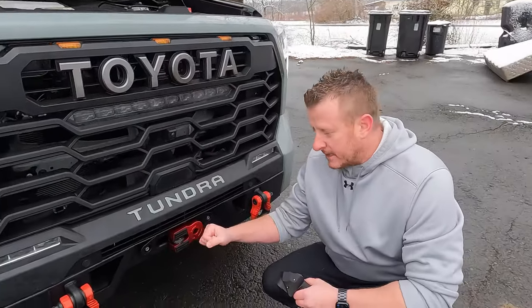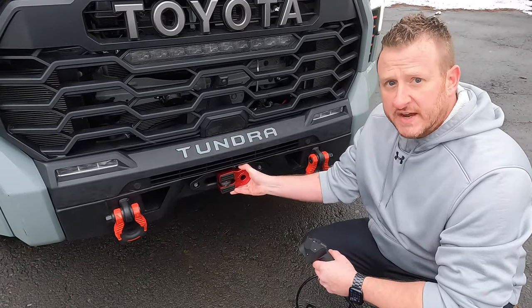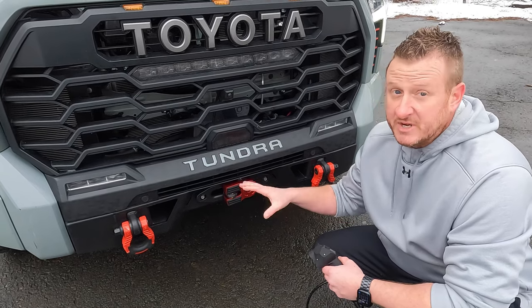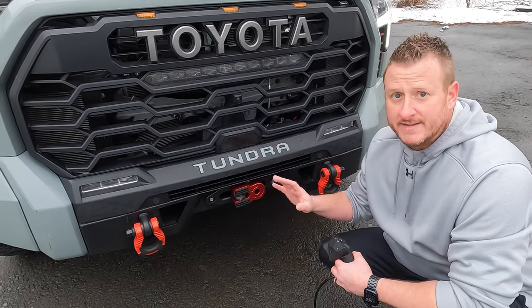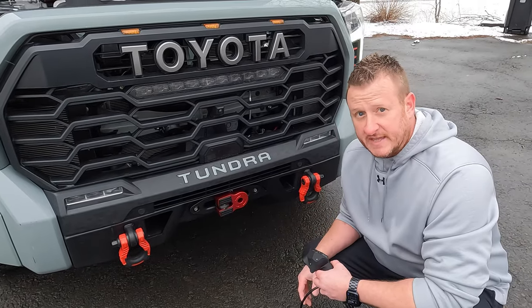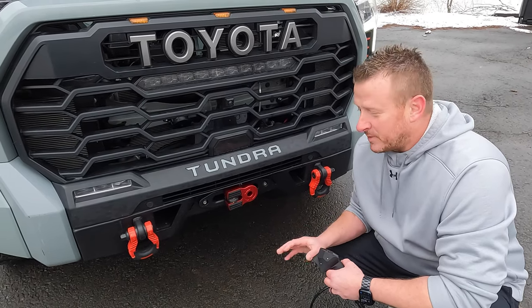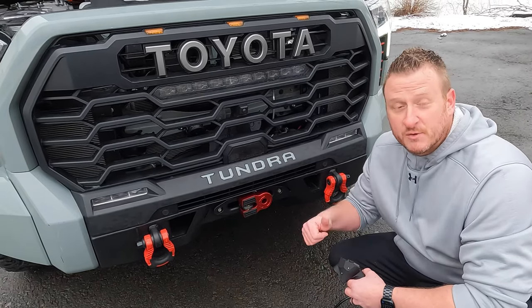I just made sure it's nice and tight — you don't want to really crank it up against the fair lead, but it's nice and snug so we don't have to worry about the rope coming undone. Make sure you're subscribed and turn on that bell. I will show you what you need to do — you need to pre-tension or pre-stretch the rope, whether it's cable or synthetic, before you actually use the winch on the trails, or you run a high risk of damaging the rope. If you guys have any questions, comments, or concerns, put them down below and we'll get them addressed. Thanks for watching — we'll see you on the next one.